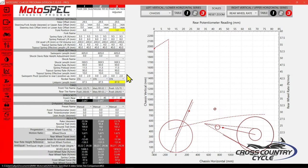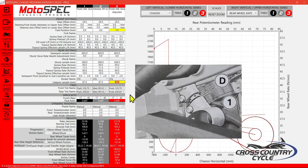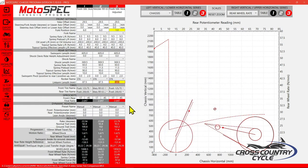If no change is made to the chassis when going to the Pirelli Superbike Slick, you'll find the bike will not be as stable due to the lack of trail — somewhat edgy and potentially twitchy. To get our trail back and restore chassis stability, we need to change the overall ride height of the forks and shock. Starting with the forks, you'll need to raise the front of the bike five millimeters so that only one millimeter of fork tube is showing above the triple clamp. Moving to the shock, it needs to be lowered by just half a millimeter by reducing the link arm length from 87.5 to 87, or reducing the gap to 9 millimeters from 9.5.